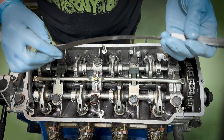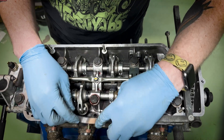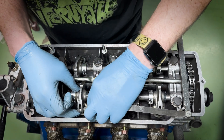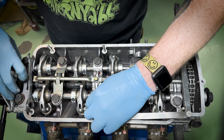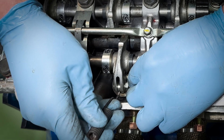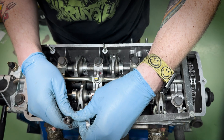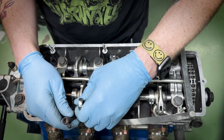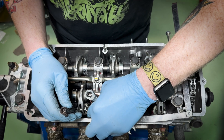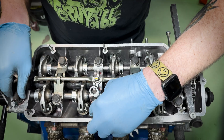I think I can do this upside down. Get our number 8 feeler gauge - this is why I like the long ones, because I can just work with it however I need to, to get it in there flat. Get my tool again in that hole and tighten it down until it doesn't want to move and actually pushes the valve down a little. I'm going to tighten this down somewhat so it's harder to turn, and then just bring it back until the gauge is free. Maybe a little tighter - there we go. Get the 7 out and now 7 should just go right in.